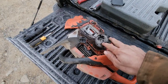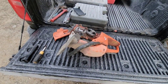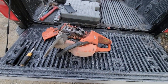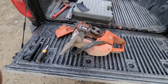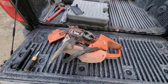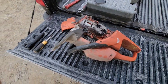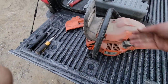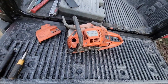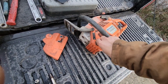If you don't have oil pumping out, you've got something else wrong. From there you've got to take your clutch off, take the plate off, and get into the oil pump. I can make a later video of that if this video gets any views. I'd be happy to pop this clutch off and give an in-depth look at the failure points on these pumps in particular and chainsaw pumps in general. These are really a great saw — this thing has cut so much wood. It's all original; I've never even rebuilt a carburetor on it and I've owned it a long time and cut a lot of firewood.